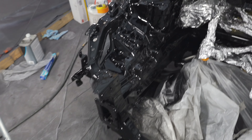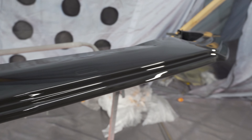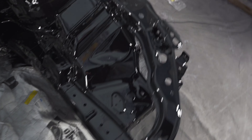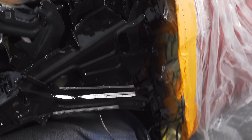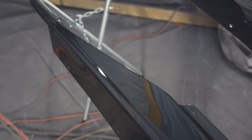It's getting pretty late, almost eight o'clock, but it gets dark here around 5:30. The front bumper is prepped out, we just went ahead and sprayed out the little cross member piece so that's all good. Now Cameron's over there getting the clear ready to spray the rest of the bay, the lip, and whatever we've got in the booth. The clear coat is going to fog this entire place up so I'm not even going to have the camera in there or I probably won't ever be able to use this lens again. After two coats of clear this is glossy — yeah, super shiny. One more coat on the bay, and these pieces came out pretty good as well, same with the lip.